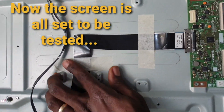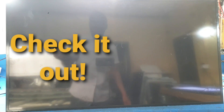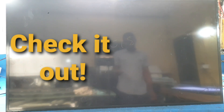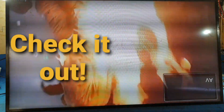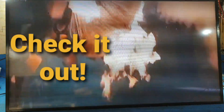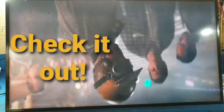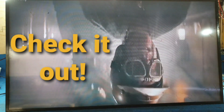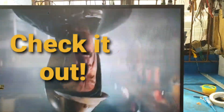Now we're all set. This will ensure that the LVDS won't shift away from place. Now we can test the screen — check it out, tint is gone. Yeah, the screen is good now. The original problem with this screen was actually a black screen, and after correcting that I saw this tint — I had to take care of this too. Now that it's all done, you can assemble. But to help you see there is really no tint anymore, I'm showing a close-up view of the display. Look closely — no tint. It's a perfect picture.